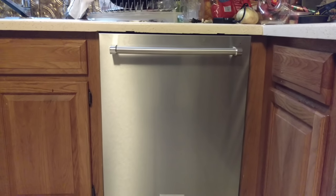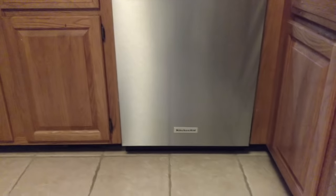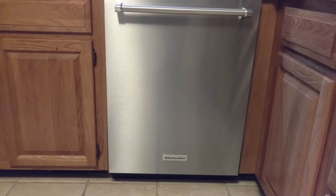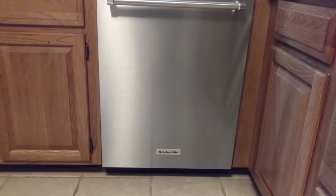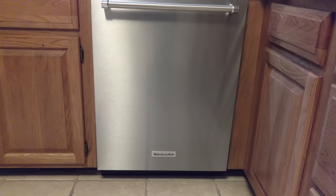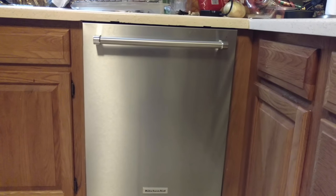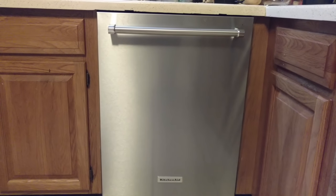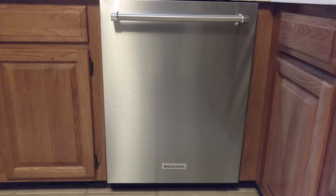As you can see, there are a couple of notches in the countertop there. That is not the dishwasher's fault — that's because the previous owners installed tile in the kitchen underneath the old dishwasher, then uninstalled it and laid tile back in, but didn't remove the cabinets. Because of the height difference the tile made, we were a little short on headroom. So if your cabinets and dishwasher are sitting on the same floor surface, you should be fine. I want to go ahead and open this thing up and show you just how much it holds — it is incredible how much it holds.